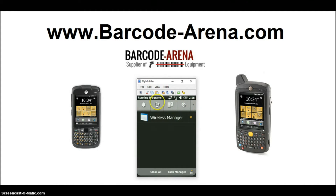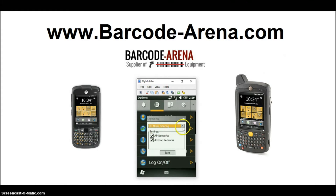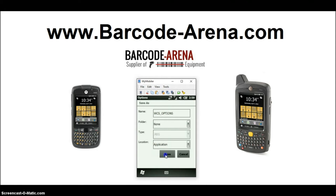Click your top bar and move to the right. You'll see an 'F' — that stands for Fusion, which is the name of the firmware driver for the Wi-Fi radio interface on these devices. Click it to open the selections menu, scroll down and click Options, then drop down the arrow and turn on both the 5 GHz and 2.4 GHz bands.